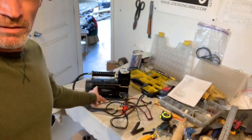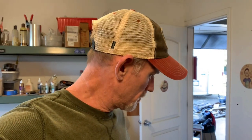You've probably seen my modifications to my Smittybilt compressor with the Anderson connectors, alligator clips, and fused Anderson clips to the truck. Today I'm going to do the pressure cutoff switch. If you've used these compressors, you know they have a blow-off valve, and when it builds up to pressure it sounds like a shotgun blast and lets off the pressure, which gets annoying and fatiguing on the ears.